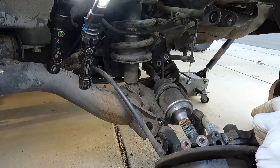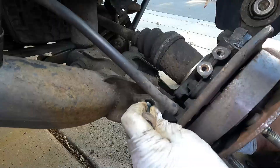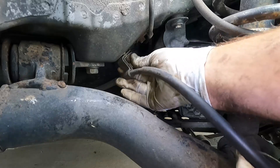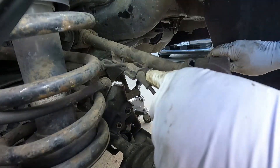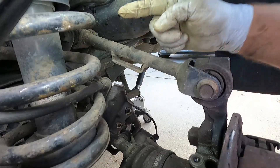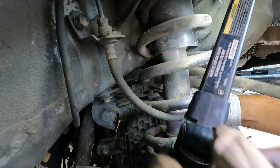Let's take it back out and put it back together. Just try to line up that axle in the center of that hub. We can put this one in — this is just that 12-millimeter bolt that holds the parking brake cable. Now I'm going to take off this mount here. Looks like these little plastic things clip in — this is for the wheel speed sensor mount. We need to follow that around underneath and take off the other connector. Back here it's just a little plastic snap that snaps into the vehicle.